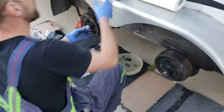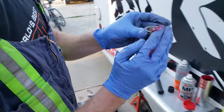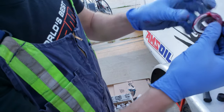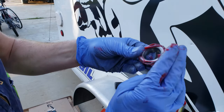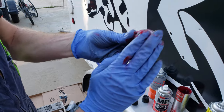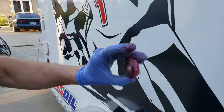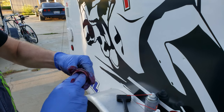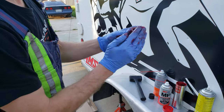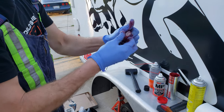I did forget to do one thing — this was the same bearing I took off the other side that was new, so I've got to re-grease it as well. This one's been greased already but I'm just redoing it a bit. Trying to get it into the back collar. You can use the palm of your hand to work the grease through. People do take their palm and run it through like this — that's the strategy. But like I said, it's already good to go.